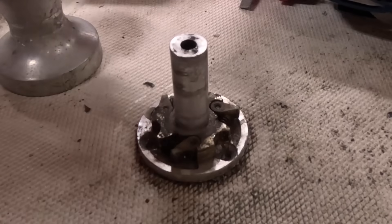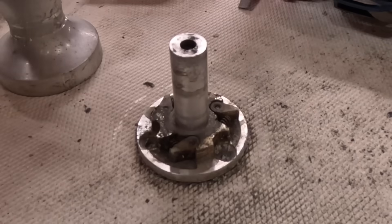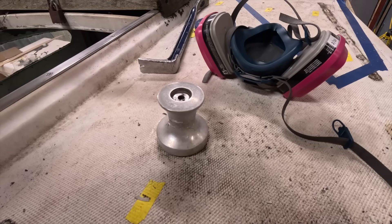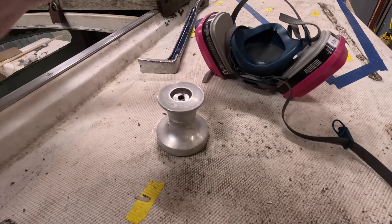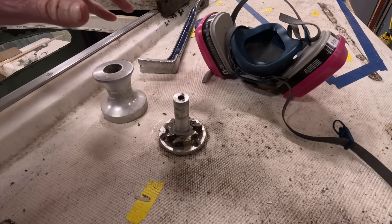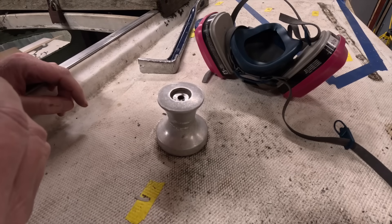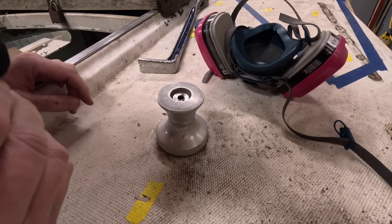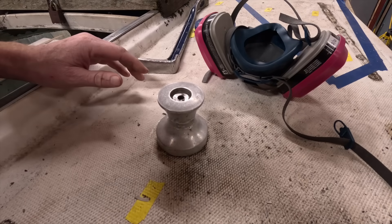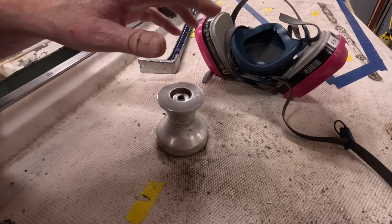The other part I found interesting is that, once you get down to the basics, winches are very similar. You've got your pawls here on a spring, and that's what clicks when you turn the drum. I'm going to set my mic right next to the winch so you can hear this. Normally when you're trying to determine the condition of a winch, you turn the drum slowly and listen to the clicking of the pawls — are they synchronized, are they all clicking at the same time, or is one slightly delayed more so than the others? And again, this is a 1970 boat. This has never been taken off; I don't think it's ever been serviced. But all the pawls are falling at the same time — there isn't any kind of delay. Normally you might hear two or maybe even three pawls clicking at different times. Not so — these are all clicking at the same rate.